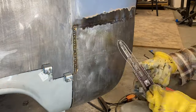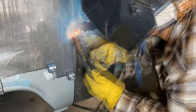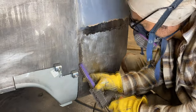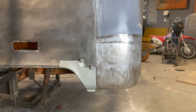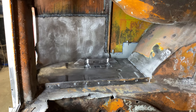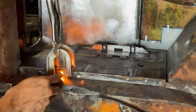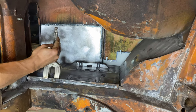The same thing goes for grinding — you don't want to grind too much too quickly. If you're starting to change the color of the metal as you're grinding, you're definitely heating it up too much and going to cause it to warp. So the key is to take your time, have fun, meditate and weld away. In the end, hopefully you have a repair that looks like this — that seam is perfect. The entire repair looks stock and fresh and I think it's going to require very minimal filler. Unfortunately we are running out of time, so if you're interested in this kind of content, don't forget to leave a comment, subscribe to the channel, leave a like, and I'll see you in the next one.